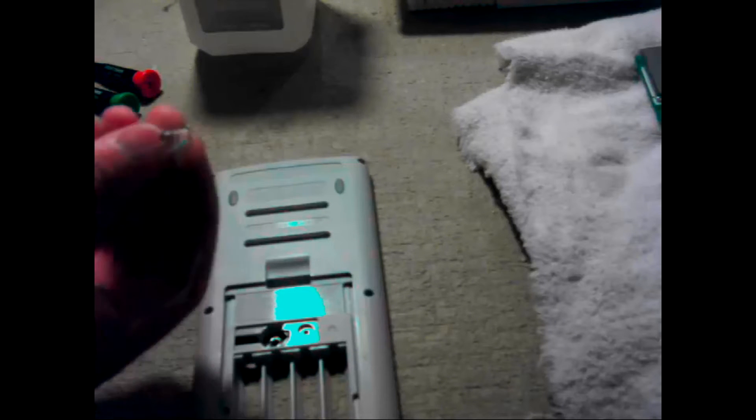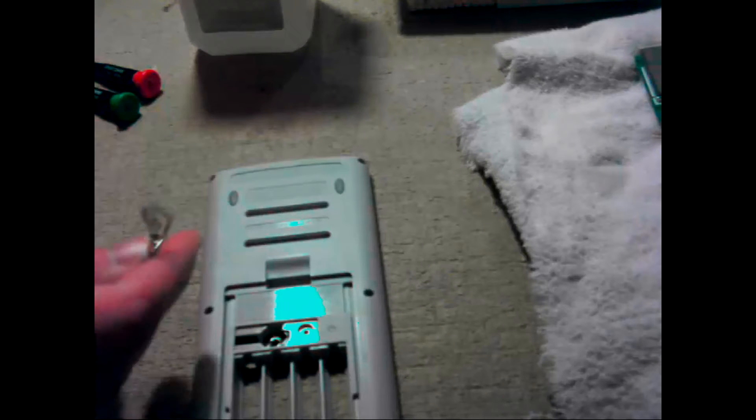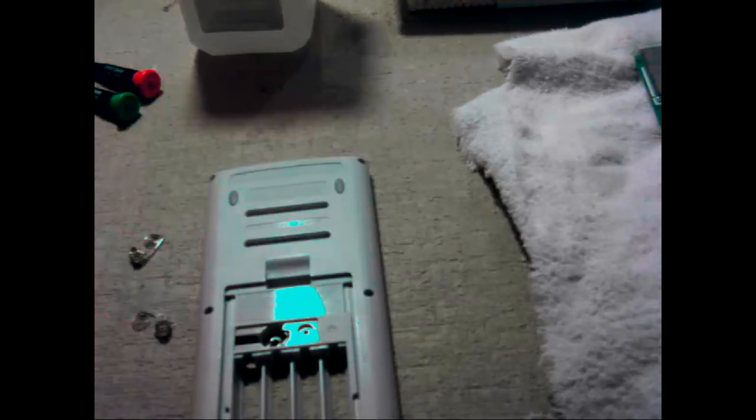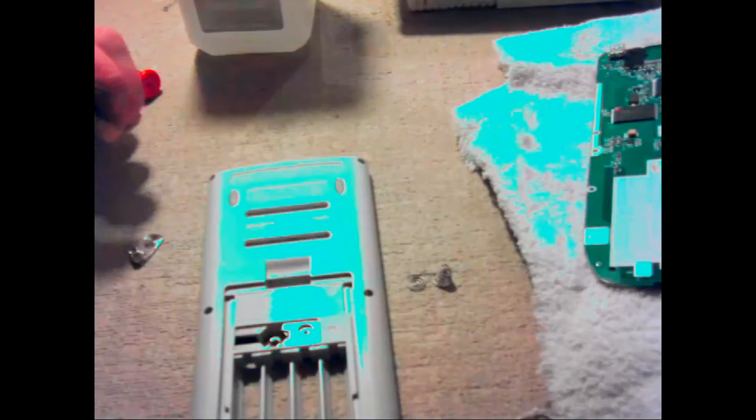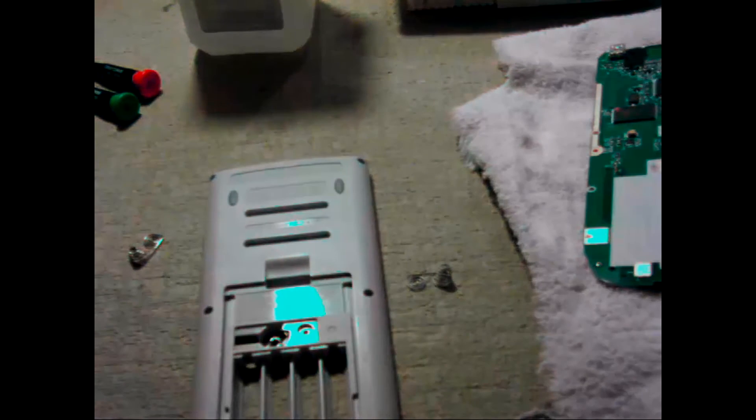I ended up pulling the contact out of the TI-83, which you saw, because the other one was completely snapped because it rusted all the way through. I'm going to put the dielectric grease on these contacts as well — especially these. I'll do these two just in case because there was corrosion on them when I took it apart. I'd rather be safe than sorry.